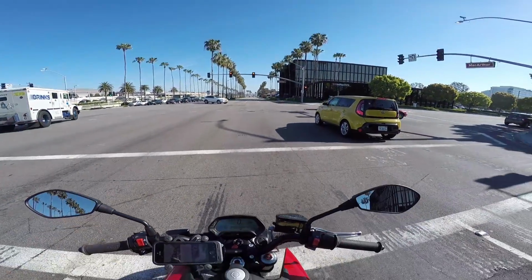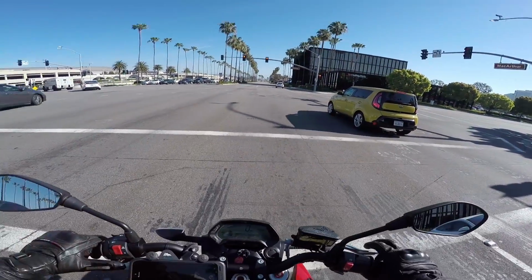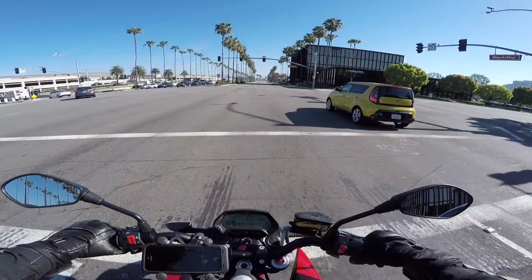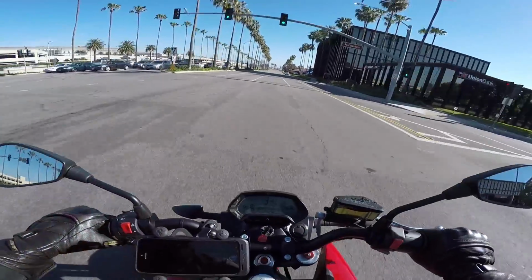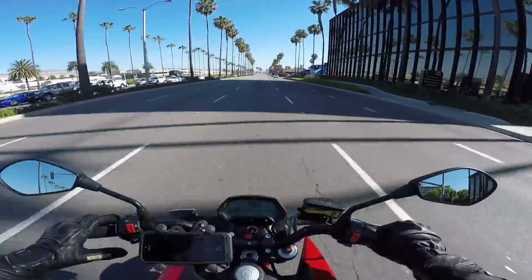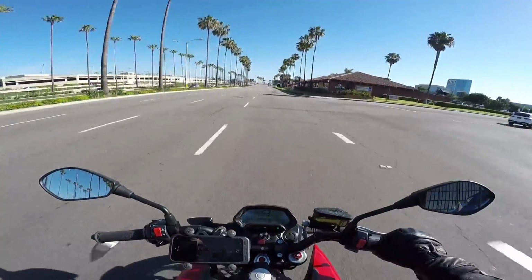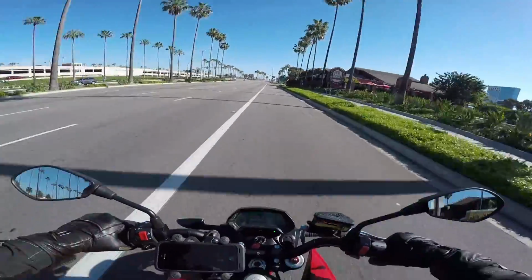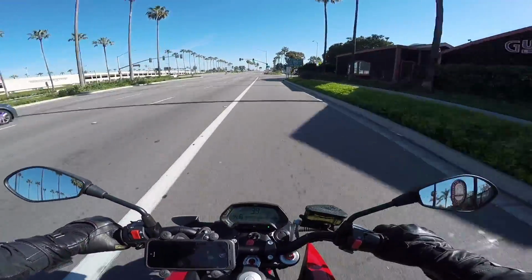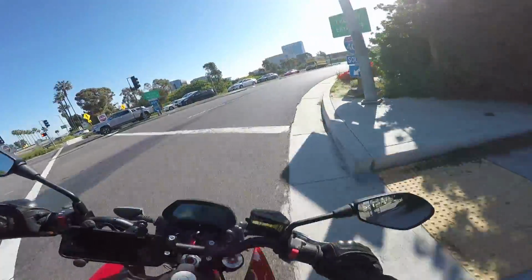Bikes in the 400 and something pound range, right? 425, 440 pounds, whatever. They have two discs up front, pretty typically. Not always, but in any kind of performance machine, that's what you'll see. And I feel like the SR could stand to have an extra rotor up there with an extra caliper. It is extra money, so I can kind of see why they didn't do it, I guess. But I think you'd have a lot more power on tap for sure with an extra rotor, obviously.